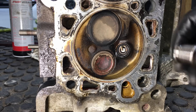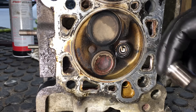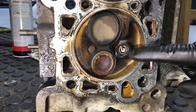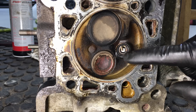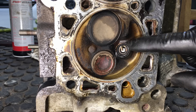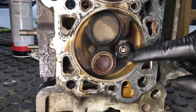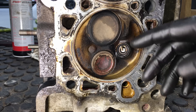That spark plug insert goes down into the head that we reamed and tapped and installed. Now you can see in the backside here — because there's a lot of misinformation out there on reaming and tapping it, and how far down to go — it just goes to show right here, you can see it comes right to the very edge. My instructions were indeed correct and it brings it all the way down in there. It's a nice clean installation.